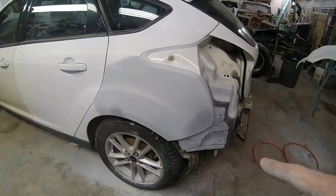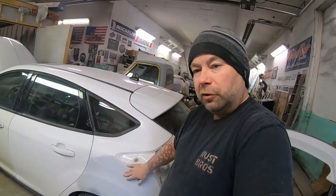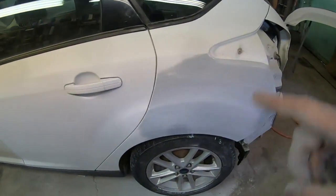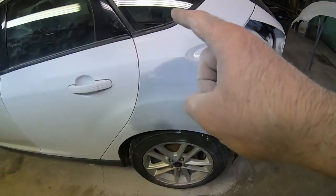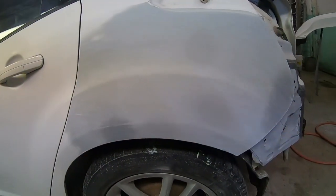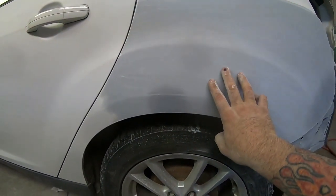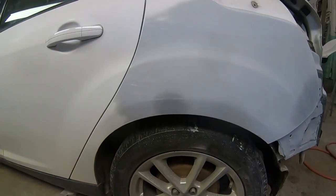And back to the prepping thing, if you guys aren't familiar, something I learned years ago was to always stick to the 100 grit rule. And that means when you switch grits, stay within 100 grits. So like I said, I went with 220, 320, 400. If you were to go, say, from that 220 grit directly to the finishing 400 grit, it's not going to take those 220 grit scratches out. You need to be more gradual. So that's the reasoning for that.